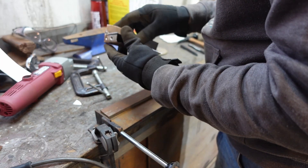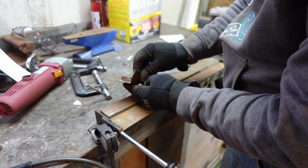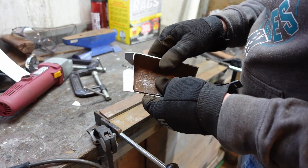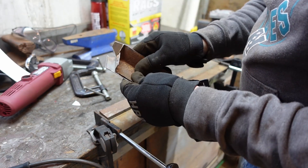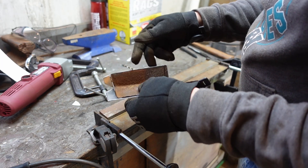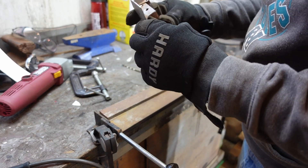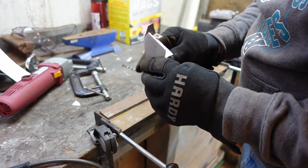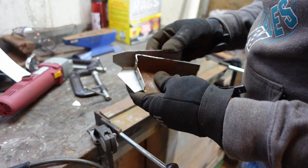As usual I went too far. There's not quite a 90-degree there — didn't notice that. Got it pretty good that time. Now to bend over the flanges — the angle is obviously important here, but this one will go straight over and then that one will kind of meet. Since that's a perfectly straight-over one I'll do that one first, and then that'll help me determine the angle on this. The piece is actually pretty close, a little bit big on this side — that's fine. You've got to watch and account for the bend in the metal and the curve taking up some extra room. That's why I didn't mind giving myself some extra metal. Go ahead and just kind of straighten this up a little bit, it's still a little wonky, and clean it up and bend the flanges.